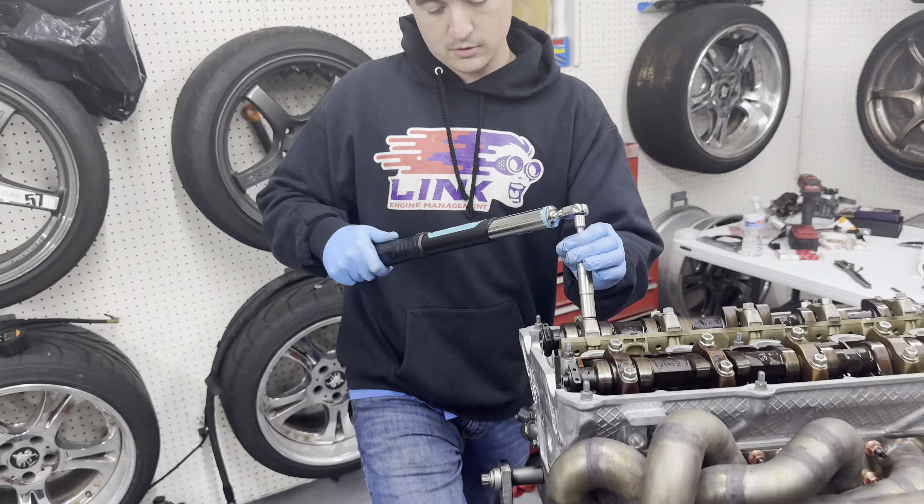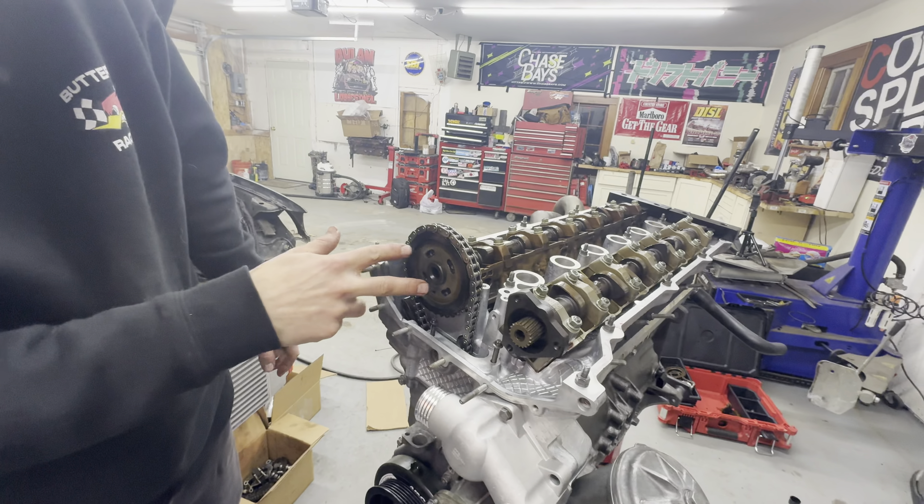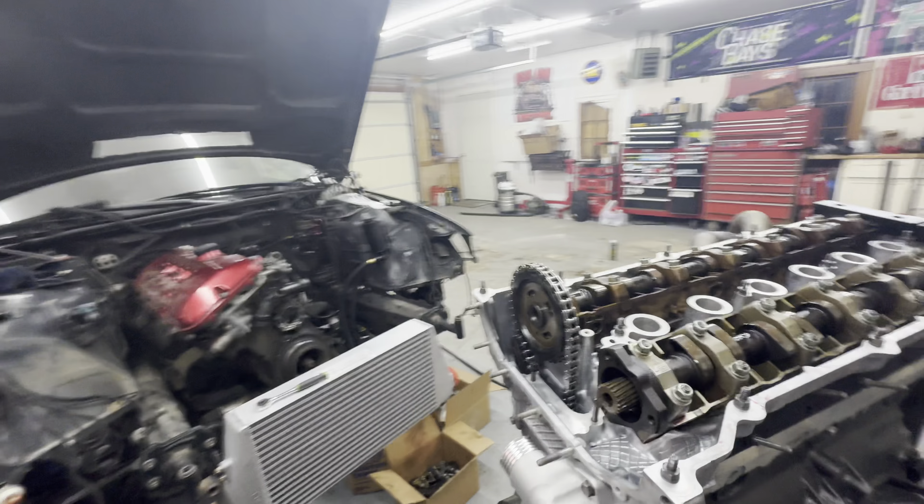Here we go, baby. We're letting Garrett work his magic here. We got the timing block set up, got the two dots pointing up on the intake and the exhaust cam. Then we got the chain over here while Garrett finesses in the sprocket. The helicoil checked out, which is nice. The one thing we have to confirm is free range of motion - you want to start with it in the center. This is your base timing, essentially. The motor's timing comes from the exhaust cam to the crankshaft, and then your advance on the intake comes from its relation to the exhaust sprocket. Everything's tightened, everything's torqued. Vanos is installed, your front sprockets are installed for your timing. There's a really good YouTube video you can watch - I watch it every time I assemble my M52s.